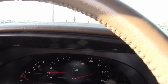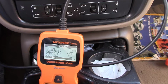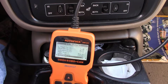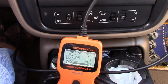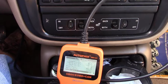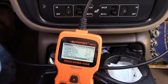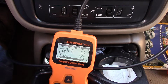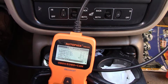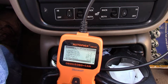Like when I was going down the freeway, the speedometer was 60 and the meter down there was 60. But when I got it to go a little faster, the two didn't match up. So sometimes it works, sometimes it doesn't. So I'm guessing, but I think it's a bad sensor. Sometimes the sensor's sending out correct stuff. See, like now I'm stopped and it was still reading like 5 miles an hour. So I know the RPMs is right on with the car. There's no lag at all.